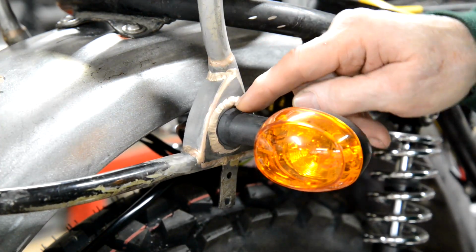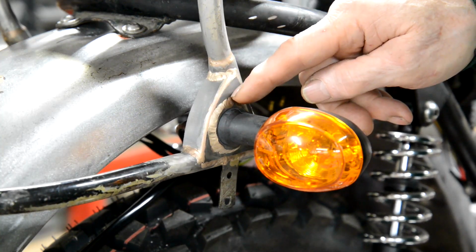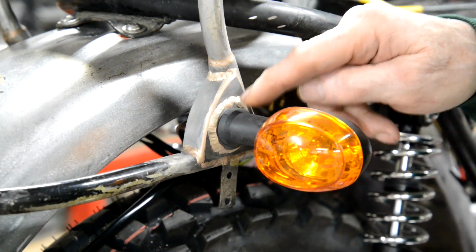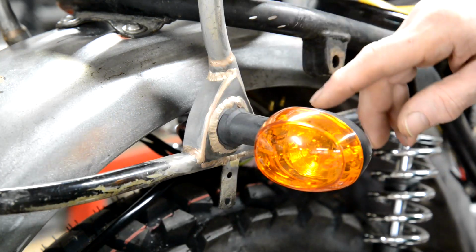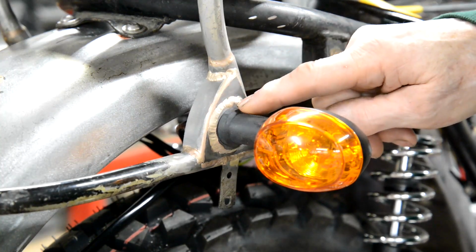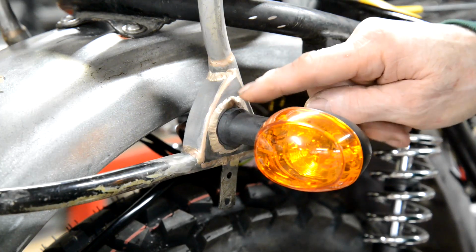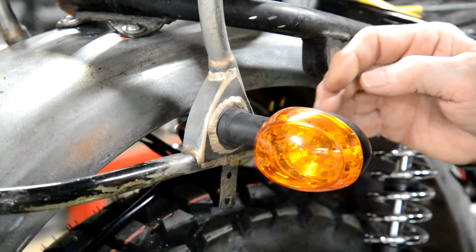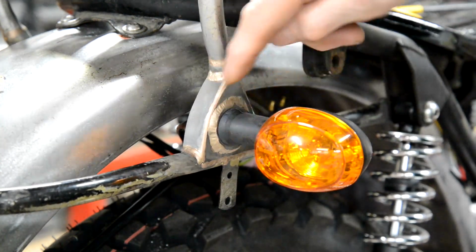So then, that was a noisy one. I was thinking about cutting this plate and everything. It suddenly struck me, this piece needed to have a hole in it. So I got one of the hole saws out, 1¼ inches, and just cut out two pieces of plate and then opened the hole out to 3/8. So what I did was I just clamped it on, actually just put a bolt through, and I tacked it at the top, the bit that's sticking out, because these were pointing downwards.